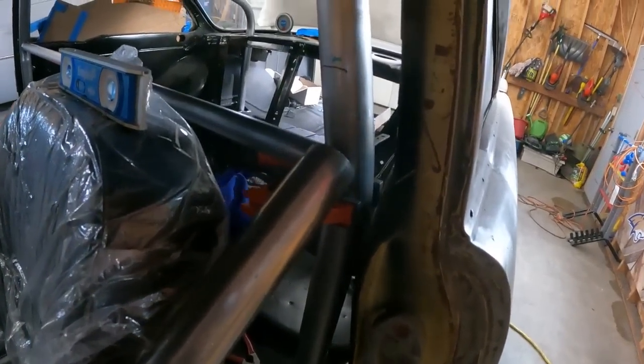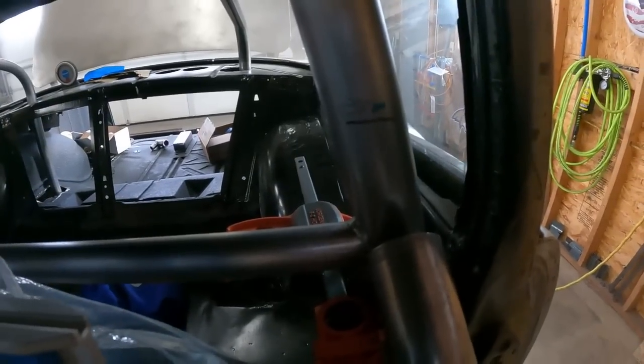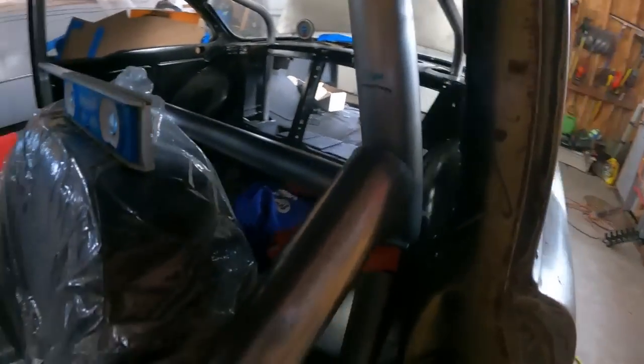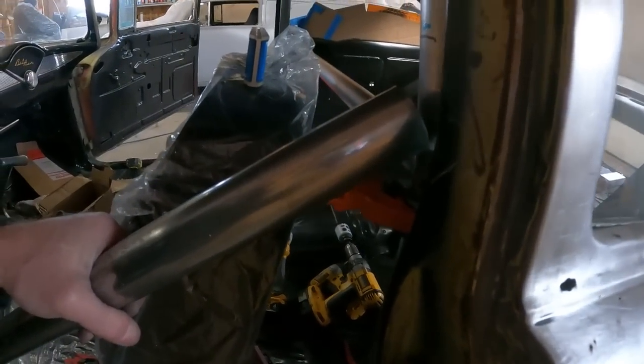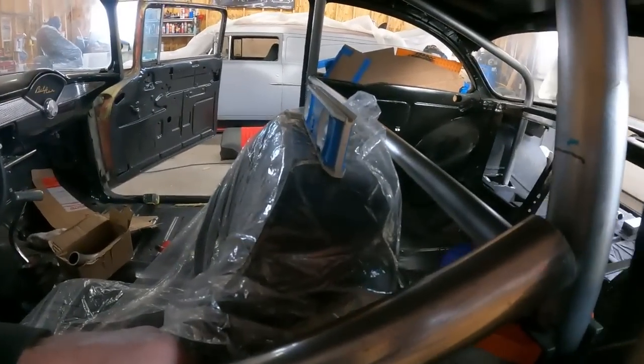Seats back in place so I can try to determine where this bar goes. About shoulder height based on my mark — it says it's supposed to cross the driver between the elbow and the shoulder. In the picture it shows the guy with his arm on the wheel and it's just below his elbow. I think if the bottom of the tube is at the black mark, it's between my elbow and my shoulder. From the outside, if the bottom of the door bar hits about where the top of the cross bar is, we're going to be pretty golden — just barely going to see the bar through the window.